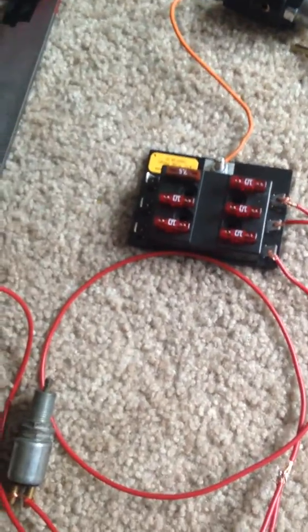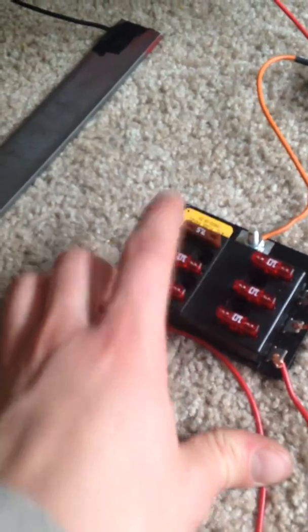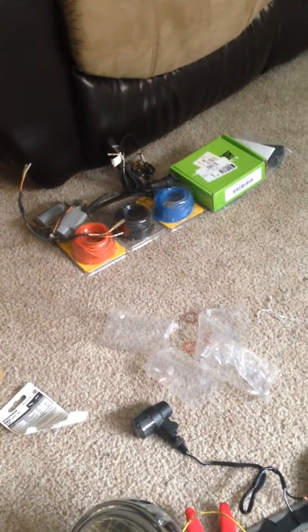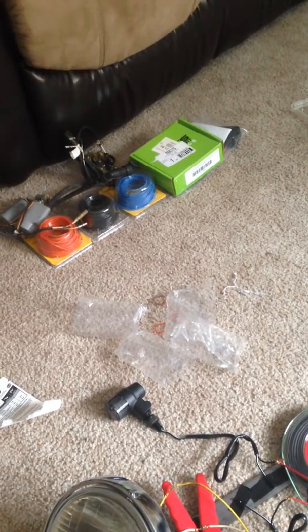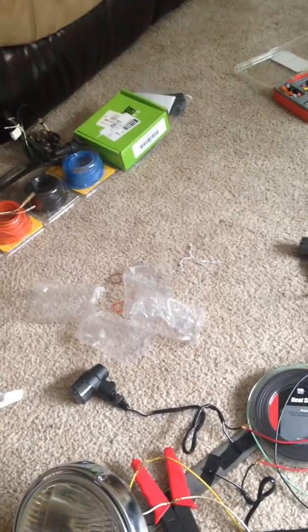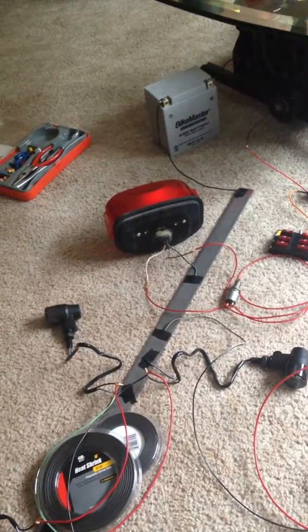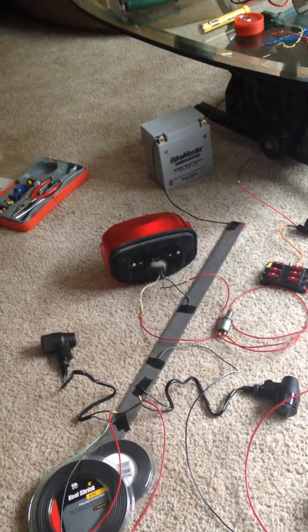Here's my fuse panel. It would have one more fuse hooked up — this 7.5 amp going off to the coils and points, and the stator. Actually, the stator and the regulator rectifier would be powering this unit instead of a battery. I'm just using a battery as a hypothetical motorcycle that's running.